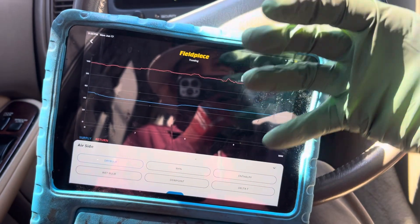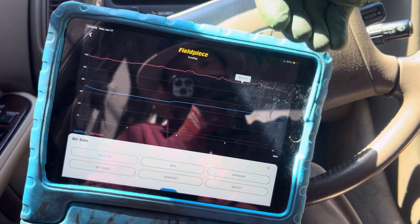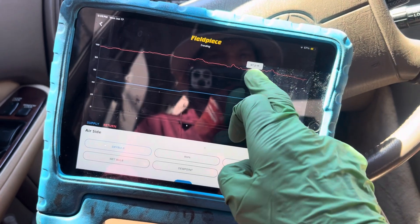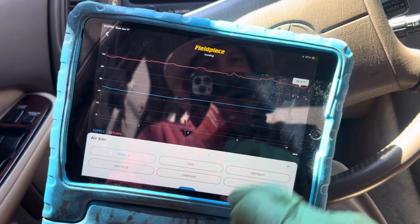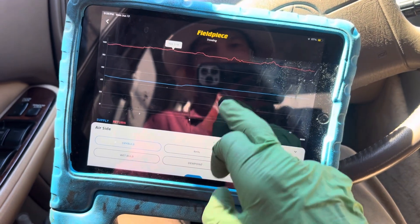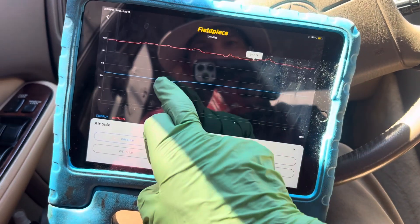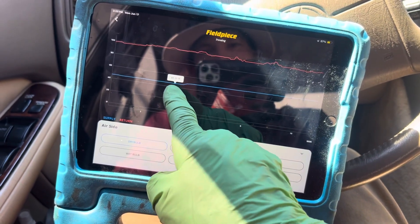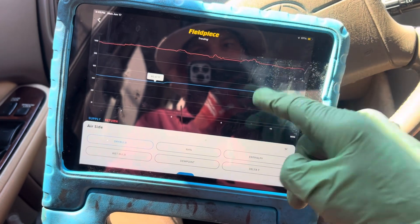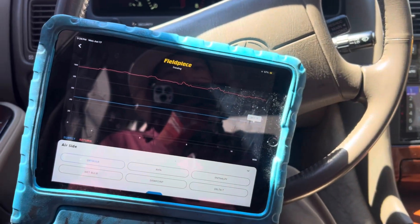The radiator heat circulates around and curves back in front of the bumper, reheating the air in front of the fan depending on how it's moving — that's why we're getting 97 degrees superheating the condenser, nice and toasty. You can see our high side went down. When the high side was up, we were at 45 degrees out of the dash. Now that our high side pressure went really down, we went up to 50 degrees out of the dash. Remember, this is an automatic system.